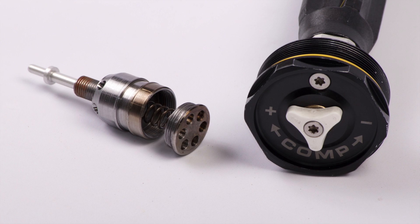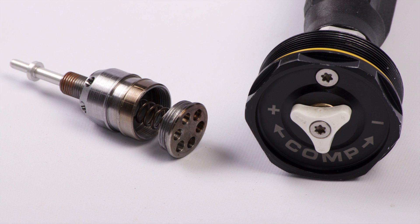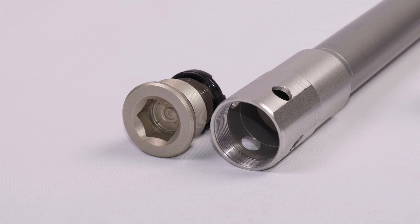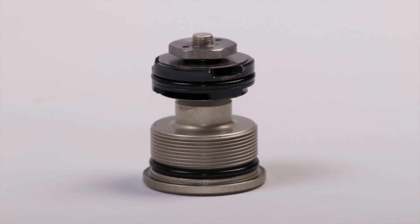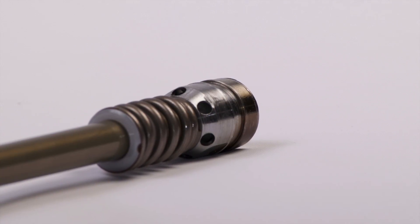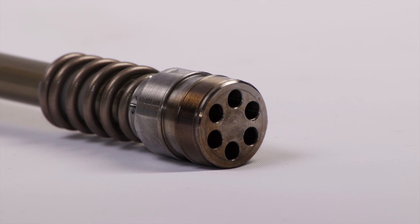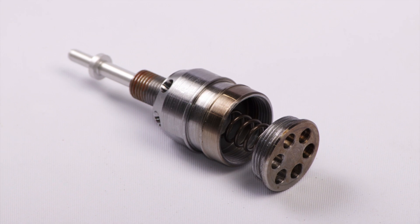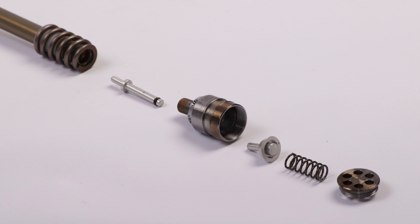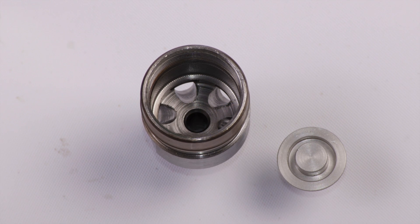Explorer left side. This is where things get interesting. Explorer's compression adjuster is located on the fork cap, so it's not physically connected to the base valve where compression adjustment normally takes place. The base valve is non-adjustable, like the right fork leg, and WP designed a unique mid-valve capable of adjusting compression damping. This valve looks trick, but it's very simple inside. It's an adjustable, fixed orifice valve. A plunger inside the valve can be adjusted up or down to change the port area where fluid flows through.